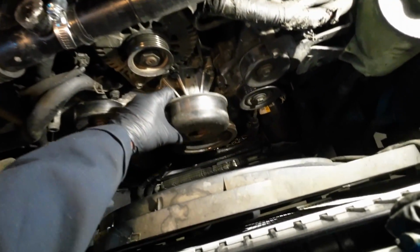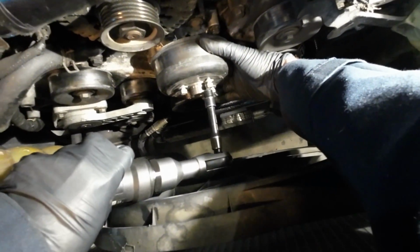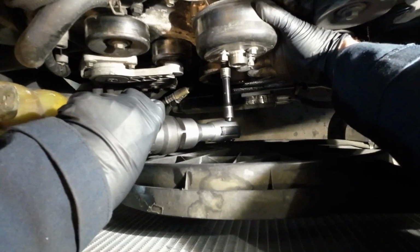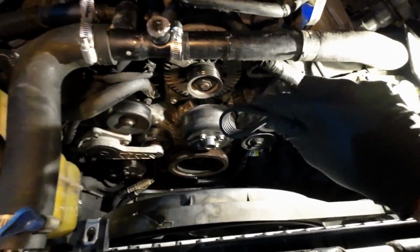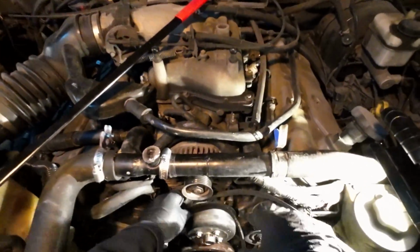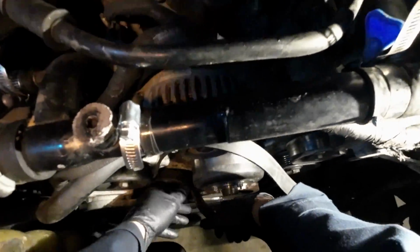All right, reverse order. I'm excited to install the water pump pulley. Little thread sealer. Can't hurt anybody. Just support the pulley from spinning. Okay, serpentine belt removal tool on standby. Before torquing down the water pump pulley, we're just going to push a little loop through the tensioner. And feed this guy up over the top, as well as over the bottom.